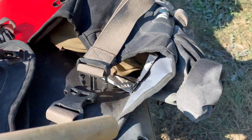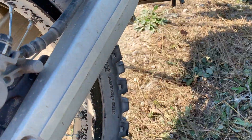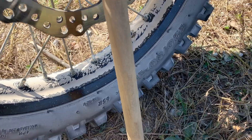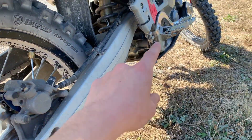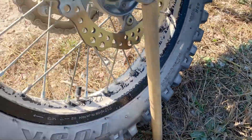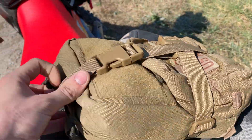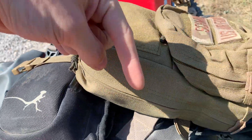So here in the right pannier, I keep a dowel that I use to prop up the rear swing arm to get the wheel off the ground. This is kind of a two-handed job. All I did was push my body up against the pannier to push the bike into the kickstand and front wheel, let it sit where it wanted to, and then wedged this in, so now the wheel spins free.